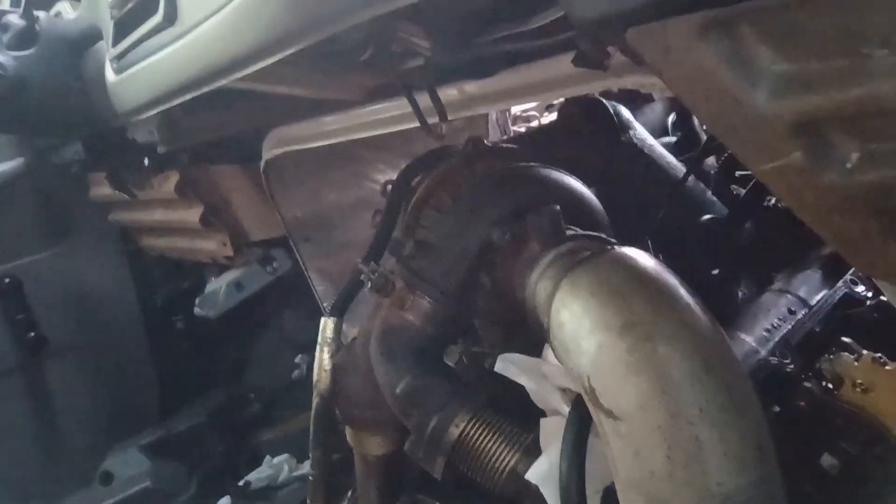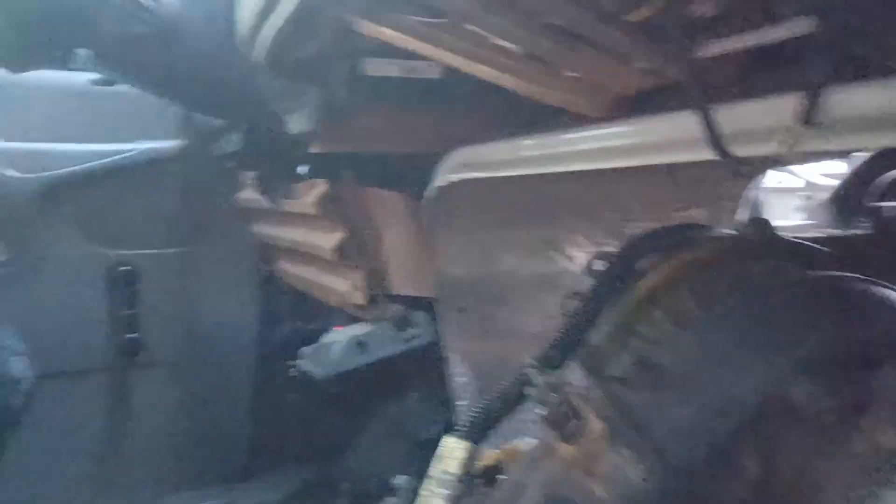I'm so excited. This has been a huge, stressful project for me. I'm not the greatest mechanic, and I'm learning a lot as I go, and to see those injectors all firing and spouting out oil is so gratifying, because this has been on my mind for months — almost a year now since I bought the van, and I knew this was coming. Now it's just a matter of putting everything back together. The turbo is a little bit worn, so I'll eventually have to rebuild it, and when I do that I'm going to reseal the fuel bowl and clean up the engine valley. But all of those projects can wait. The turbo wheel's a little chewed up but there's no play in it, and the fuel bowl only leaks when it's real cold, which is a pretty common problem. Those are all things I can do over the summer when I have more time and more cash on hand.